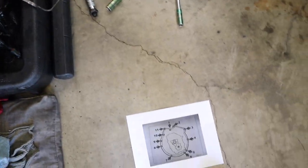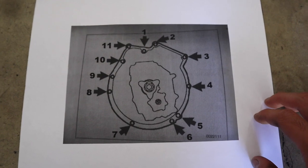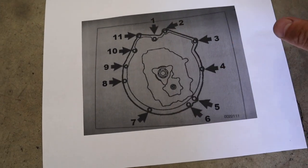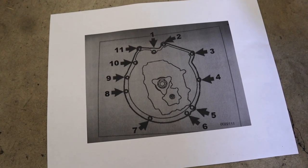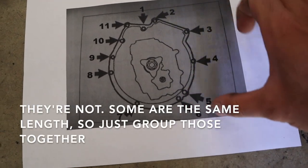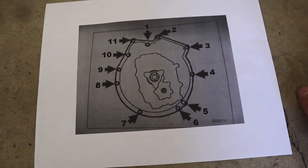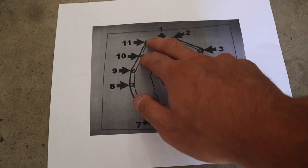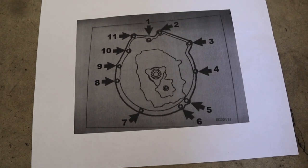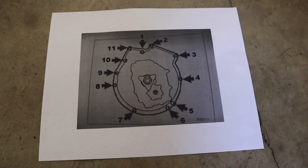Once the slave cylinder is removed, the transmission is pretty much ready to drop. I printed this out from the DIY I found online — I'll link that in the description. The reason I printed this out is because the bolts are all different. I'm pretty sure it's an E10, an E12, and an E14, and all of them are different lengths. I'm going to take each one out and put them next to the position on this paper. The top two ones are the starter bolts and you have a 10 mil here and a dowel pin somewhere. I'm going to start that and we'll see how it goes — I'm sure this part's going to be hell.